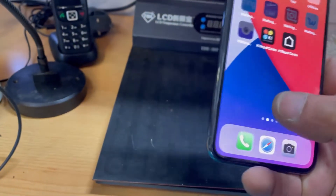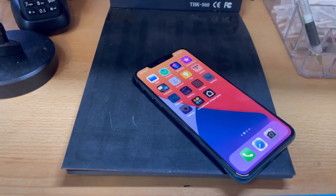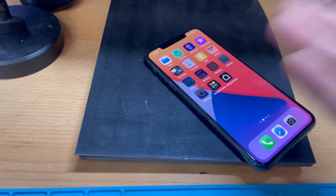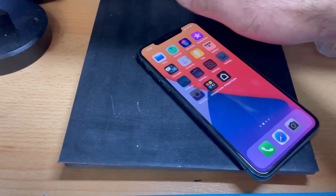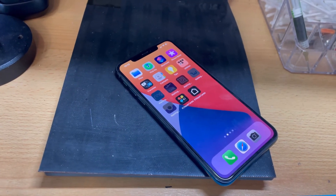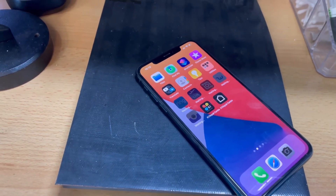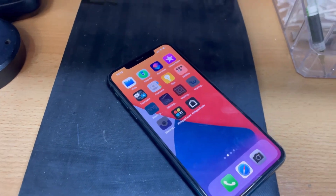It's working, but this is not a proper repair — this is a cheat repair and is not recommended for customers. If a customer brings their phone to you to repair, you should open it, re-solder properly, and do it the right way. However, if it's your own phone and you don't have a repair shop nearby, this is a good idea just to be sure you're not burning the phone down. I'd recommend a maximum of 200 degrees, because at 225 if you're moving things around you could damage the internals. I hope this video helped — let me know what you think. For any repair — phone, computer, accessory, or Xbox — send it to us at k1repaircenter.co.uk. Thank you for watching, keep safe.